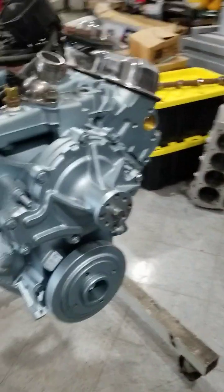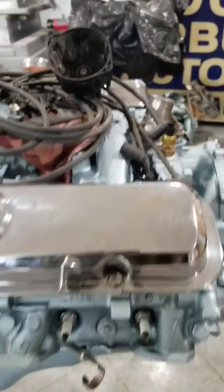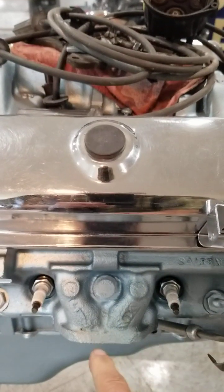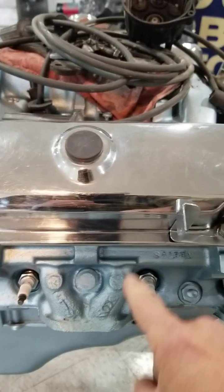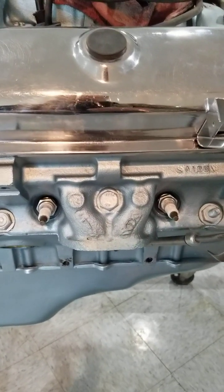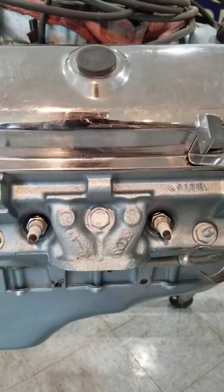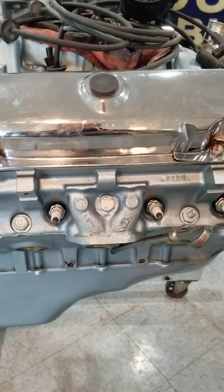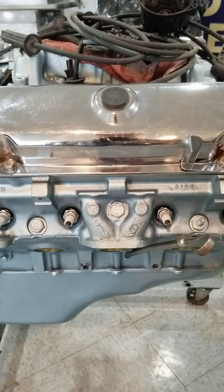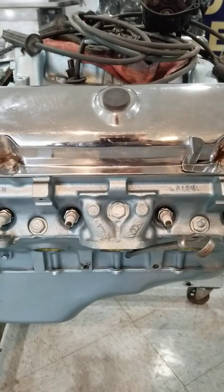This is a 1968 400 on the stand that we just completed. Right here on the center exhaust ports where the V shape is — D ports typically have a V shape, while round ports typically have straight exhaust ports. This casting is casting number 16, which is a common head for 68 and 69 400s and 428s. It's a high-performance casting used in 68 and 69, with a 211 intake valve and a 177 exhaust valve. Combustion chambers are rated at 72 cc's, though they usually end up being around 75 cc's.